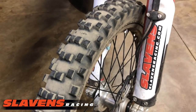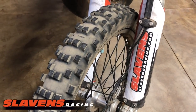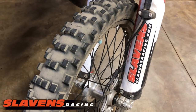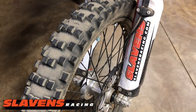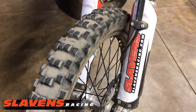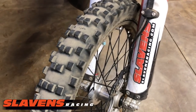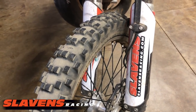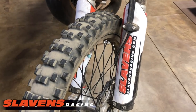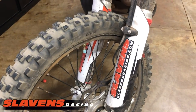I kind of attribute that to two things. One is a little bit softer rubber compound — they call this a medium compound tire, about a 65 durometer. Whereas most motocross front tires are in the 75 durometer range, even up to 80 — so they're a harder rubber compound. This slightly softer rubber compound combined with a more substantial carcass is what I think makes it absorb the rocks and roots better. That carcass will also give it more puncture resistance and should make the tire last longer.